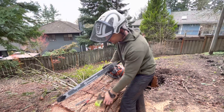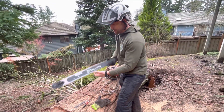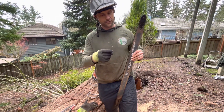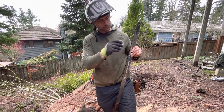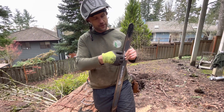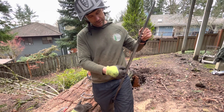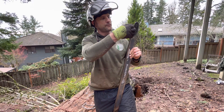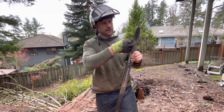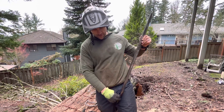Anyway, I just noticed that was the problem with my saw. A tip that I use all the time that I don't think a lot of people know about — they don't have a lot of tools for this that I've ever seen — but if you find the right gauge wire, just by putting it into your bar, you can make a really cool cleaning tool because it's flat at the bottom. So a flat wire, the right gauge — I don't know what gauge this is, it would be easy to look up — but this wire fits.